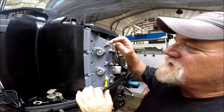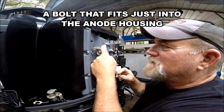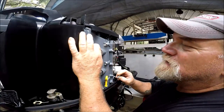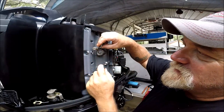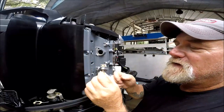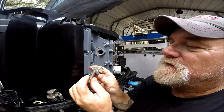The next step is, when you take this bolt out, you want to find something that'll go into just this aluminum piece without going into the whole motor. I'm a fisherman, not a Suzuki mechanic, but I do the little things. What you want to do is have something that'll thread just in there, because this bolt goes in and into the actual engine and holds this cap in here. If you find a little bolt that'll just go in the end, all you have to do is wiggle this out. You can see how far that went in — it gives me just enough purchase on this part to wiggle it out.